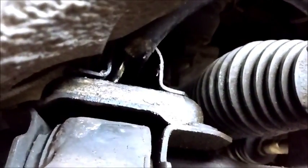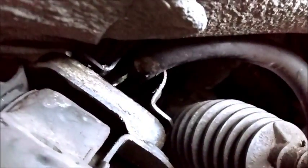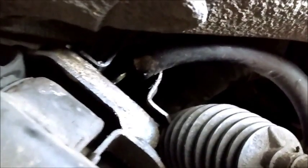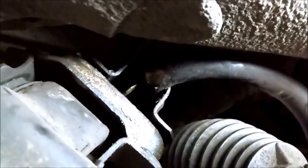So that's what I did on the other side. The bar is movable so you can manipulate it around a little bit. What I did was pull the bar forward, then fit the rubber over the bar and the clamp over the rubber, put it on as best I could and then moved it back so it slid over the actual bolt. So if you imagine the rubber's already in there and you've manipulated it in, then you slide the actual bar back - that gives you your space to then re-bolt.